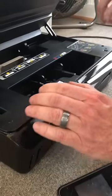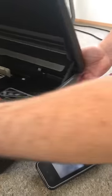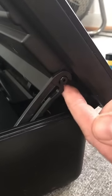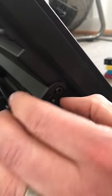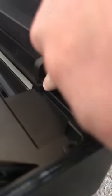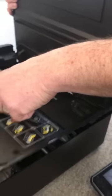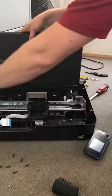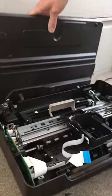Now we have the control head out. There's a hinge here, and as you can see it's open in the back. You're basically going to want to pull this arm forward, and that's going to release the whole top section. That allows this to tilt back. Now you can get the screws — one here, another one here, and two more over here. Once those are off, the whole top can come right off. There's another ribbon cable connecting the top — be careful with it.